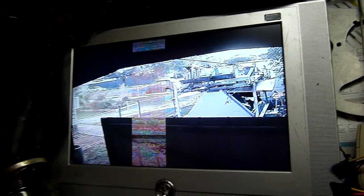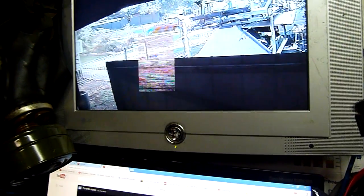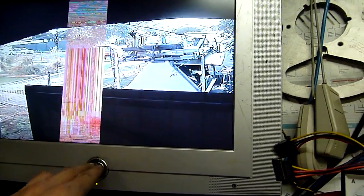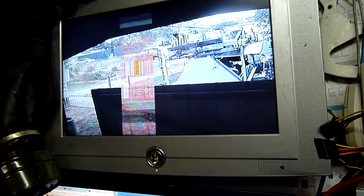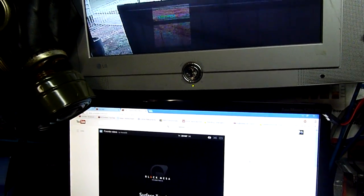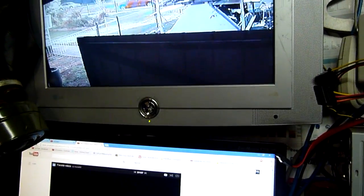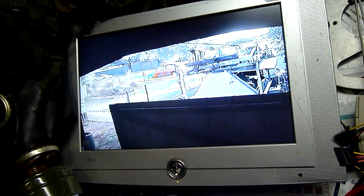Settled down for now but this thing's almost gone. If your monitor's doing stuff like this, you could take the back off and try to re-seat the ribbon cables. But generally it's the actual connection between the glass and the ribbon, or it's the little chip-on-film semiconductor attached to the panel itself. A replacement will be the same but with LED lighting and a much lighter build, so not a bad idea to replace the old thing.